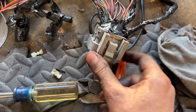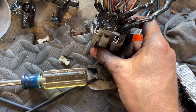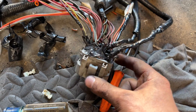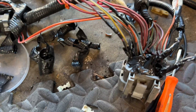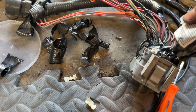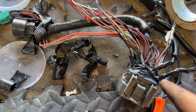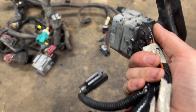I kind of just did a little bit of a bold move here — I put a ton of silicone in the wiring harness. I thought maybe these wires would continue to break over time, especially since they're breaking right at the connector, probably where they're getting bent. Now that they're all repaired, I went ahead and just gooped everything. Hopefully that'll keep them stable and keep them from touching and breaking. I definitely am never going to be able to unpin this again, so that's pretty much a permanent harness right there. But that's so much better than having some sort of weird wiring short I can never solve. It's the next day, and this thing has definitely dried out and successfully preserved all of my wires.